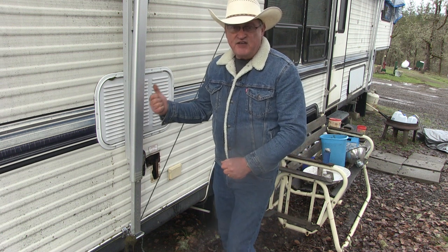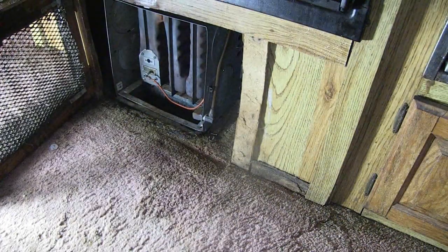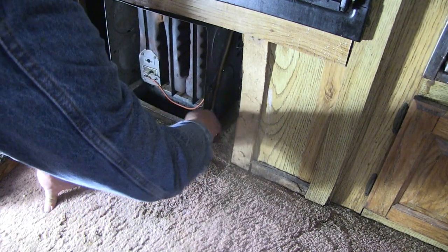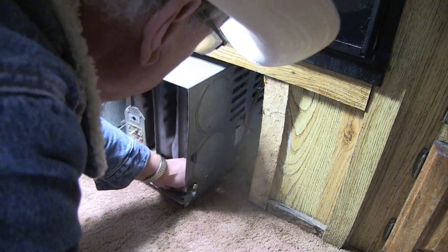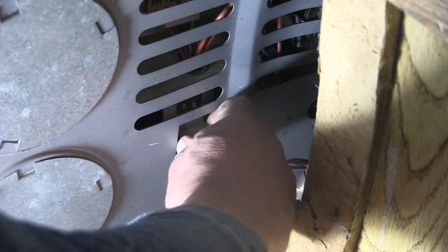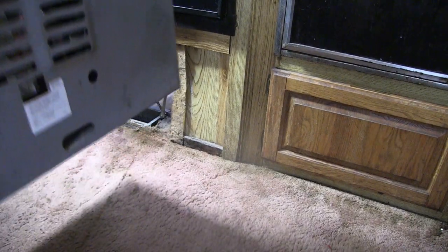Let's go inside and finish taking this thing out. This is the bay for the furnace inside — it's located directly under the refrigerator. This is why I had to turn the gas off: I'm just going to disconnect the gas right here at this union. Now I'm just going to pull it straight out, but don't pull it out too far because you have your electrical connection right here. This is 12-volt. It has a little tab on the side — just pinch that and pull it straight out. And it's time to remove the whole unit. Getting it out was quick and easy. Let's go to the greenhouse.